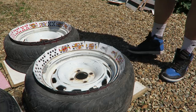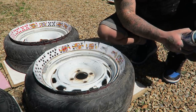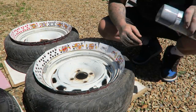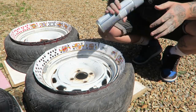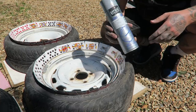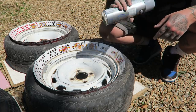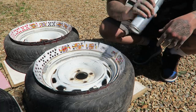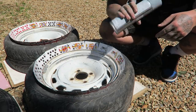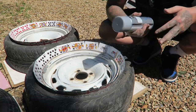What I'll personally be doing is priming these twice - two coats of primer - and then doing maybe three or four coats of the actual white, then one or two coats of clear lacquer on top. From my experience: two coats of everything, three or four coats of the main colour, then lacquer over the top. We're using Upol stuff off eBay - used it in the past, thought it was the go-to. I also want to point out I'll have to keep the wheel weights on as I just can't get them off. Right, let's start priming.